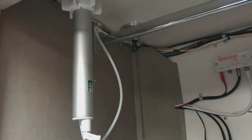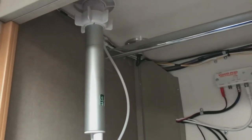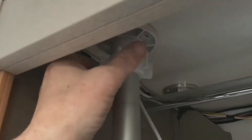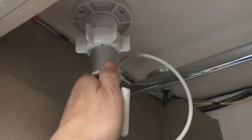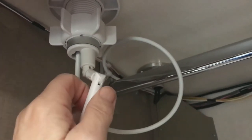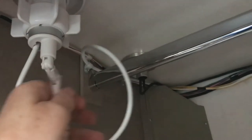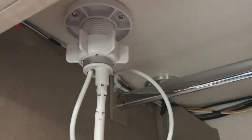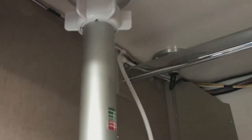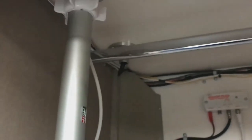If the TV comes up saying there's no signal, the motorhome is fitted with a telescopic aerial to help get a signal. Simply unscrew the gland and pop the telescopic aerial up through the roof. You also have a small handle here that you can turn — this is a fine adjustment to help get a signal. Remember, before you drive away, pull the aerial down into the travel position, which is where the green is facing the front of the motorhome, and remember to tighten it back up.